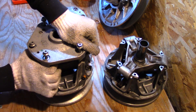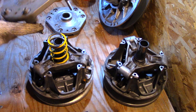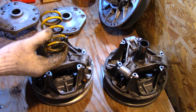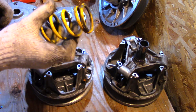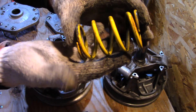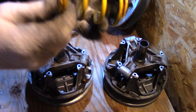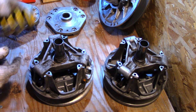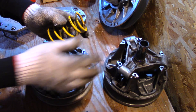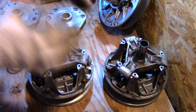As I'm taking out the last bolt, right as I take that last one out, it really wants to spring up on me. So here we go — here's the inner machinations of our good clutch. I should actually take a look at the other spring and see which one is better, because these springs have a specification for the spring free length. We're going to check the weights and make sure they are what we need from clutch to clutch and make sure they're calibrated properly.